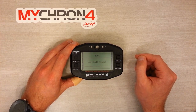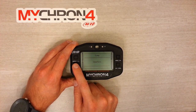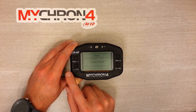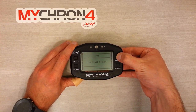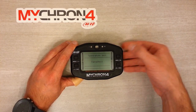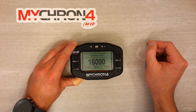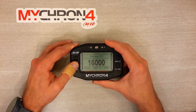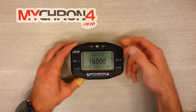The next question is what type of clutch do we have on our cart? The TAG cart has a low stall clutch; other options are gearbox for shifters, high stall clutch for something like a Yamaha clutch cart, and direct drive. I'm selecting low stall clutch. Next, what temperature unit do we want — Fahrenheit or Celsius? I'm selecting Fahrenheit. Then, what's our max RPM? I'm on an X30 motor so 16,000 is appropriate; you can adjust in 2,000 RPM increments. Set this just beyond your max RPM as it scales the RPM band at the top of the display. The next setting is the RPM tattle — the big RPM warning light — the threshold at which it lights up. I'm selecting 15,700 RPM for my X30.